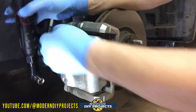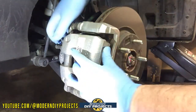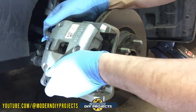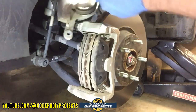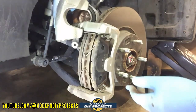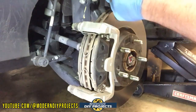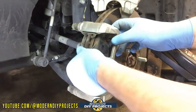And that just comes right out — see how easy that is, no problem whatsoever. So we take this out of here and there you go, we get the caliper off. The caliper is not too bad — a little rusty and dirty on the inside, but it doesn't affect your braking. I'll clean that up in a moment. These are where the pads are right here. Put your caliper somewhere it won't fall off, and let's take a look at these.